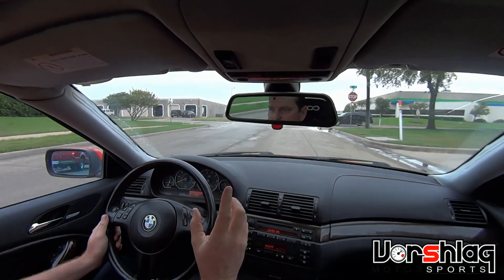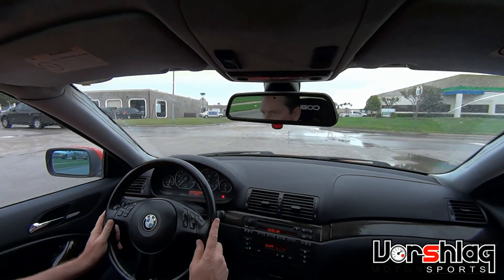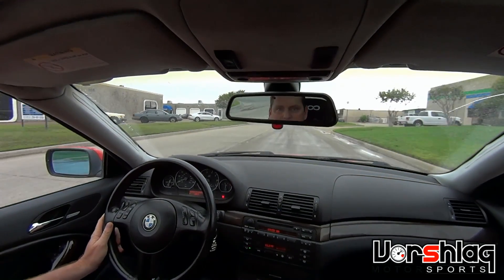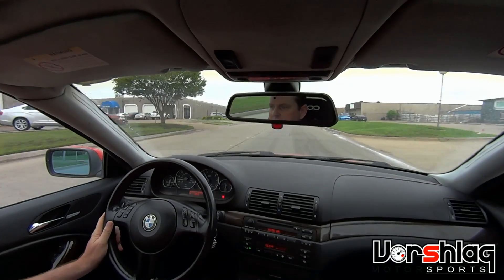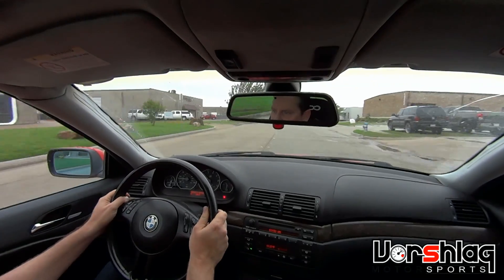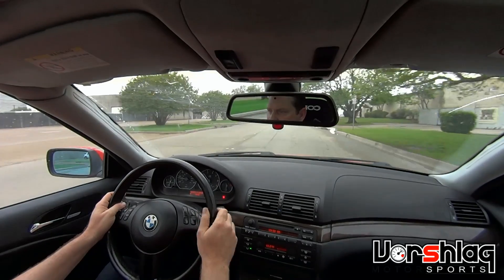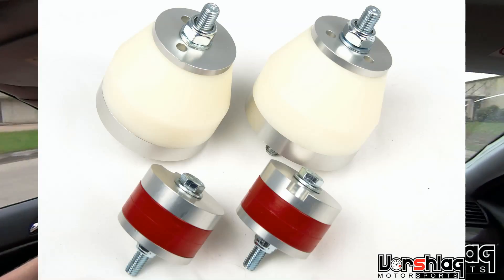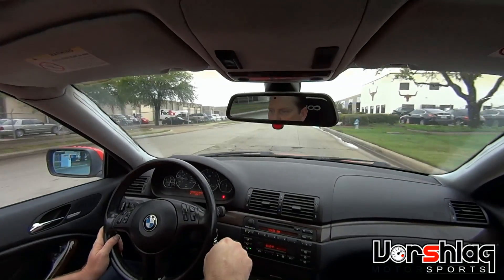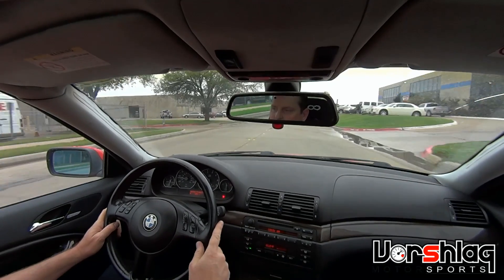It's not as good as it was with the soft conical super-soft OEM kind of spring rates that the PSS kit came with, but it's very, very manageable. I'm driving around on these Plano roads and I'll run over some of these reflectors — it's totally livable. The motor mounts and transmission mounts we put in here are our full race mounts, basically solid. The nylon motor mounts add a lot more vibration than the ride quality does.